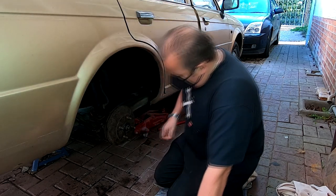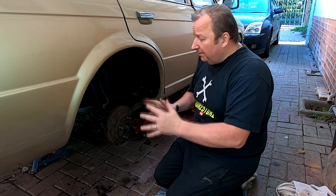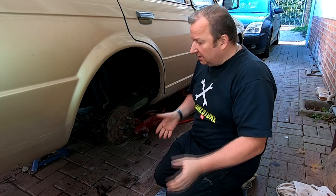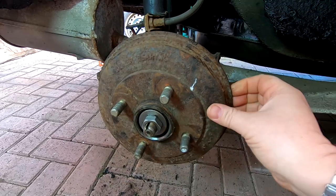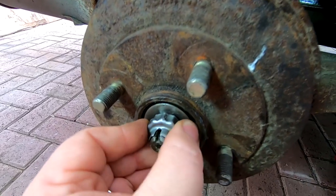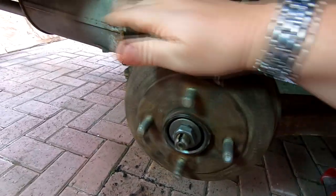I've put it all back together now. I'm not going to spend money unnecessarily, so all I'm basically doing is taking this off. If these were in need of extra work, I would have obviously bought new pads, new cylinder or whatever. All I've had to do basically is just clean it up. That's the nut back on there. Now you may notice I said that was hand tight — well, it is supposed to be hand tight, that's how you adjust it. You don't put a big force on that. Once you've got it to that stage you get your little cap, plonk your little cap on. And you're looking at basically lining the cap so that you can get a pin through it, because that locks it on. Just going to give it a little tweak like that — that's all I'm going to do. And that drum's rotating with no play in the bearing.